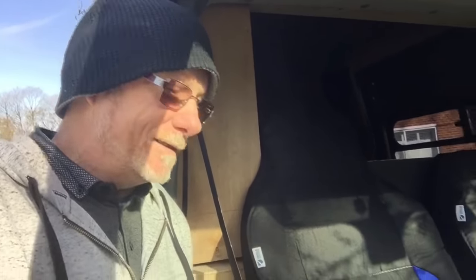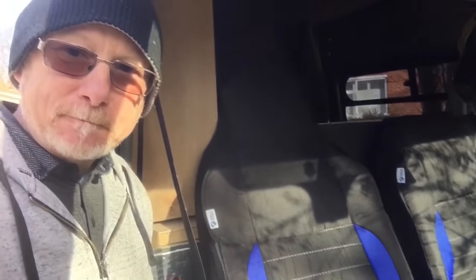So let me try and keep this simple. My van has got a standard alternator. What that means is when the engine's running it produces a certain amount of voltage — around 13.6V — but the exact number isn't important. The thing is, it stays the same. It's constant, no matter what the speed of the engine is, no matter the state of my battery under my driver's seat. The voltage is consistently the same and the engine is under the same amount of load.